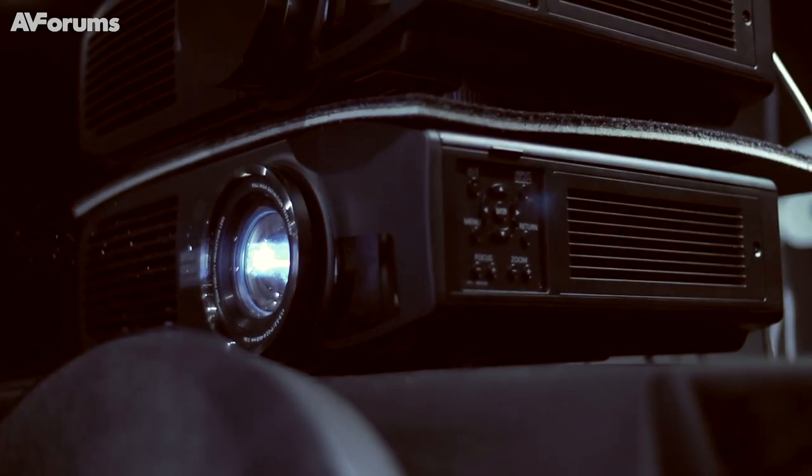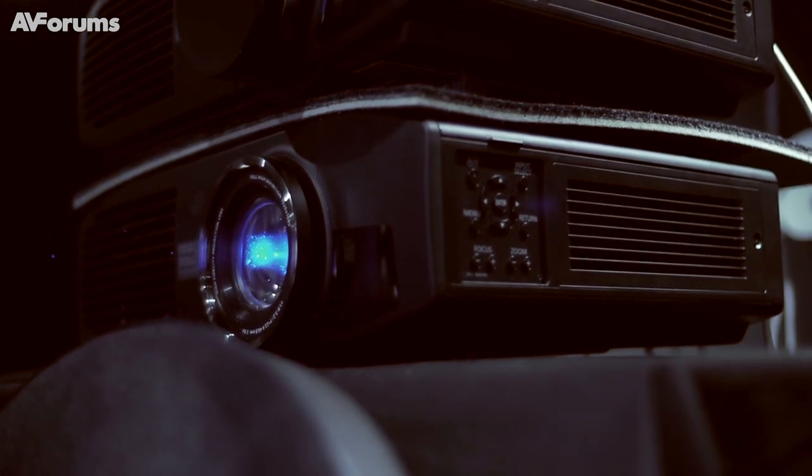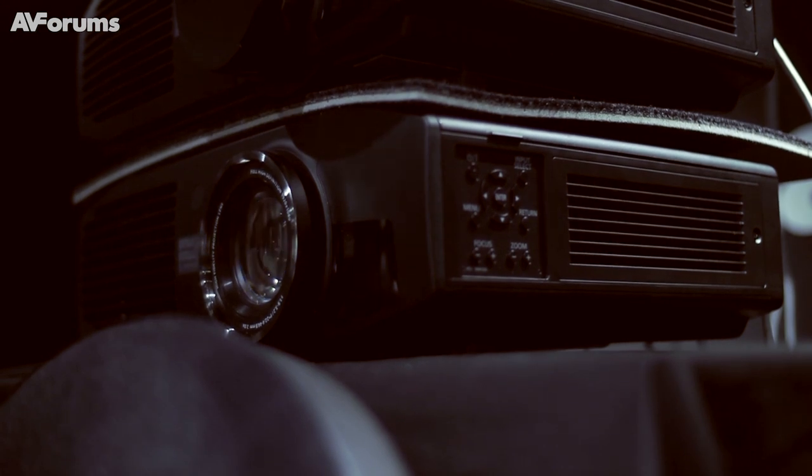Some of the changes we made in the AT6000 optics include adding the new 220-watt lamp — a Ushio lamp — going from the 200-watt lamp in the AT5000. But increasing the wattage of the lamp increases the internal heat of the projector, so we had to go back to the whole optics and change many parts within the AT6000. One example is the prism: before, we had the prism on its own, but now in the AT6000 we actually attach the polarization filter directly onto the prism, which helps cool down the polarization filter significantly so that you still get the same lamp life with the increased brightness.